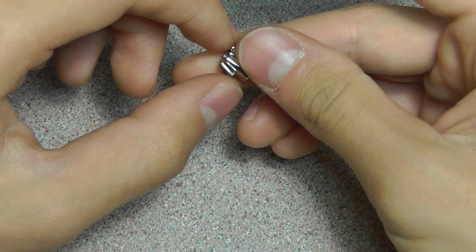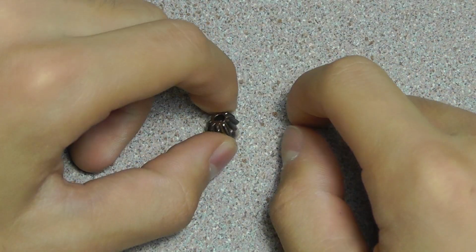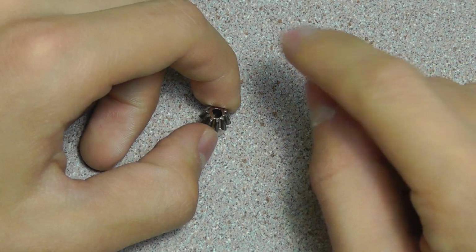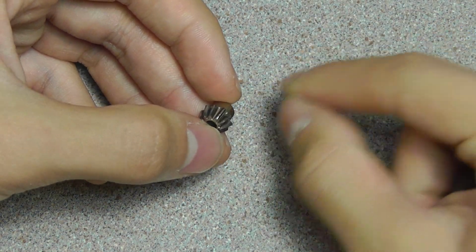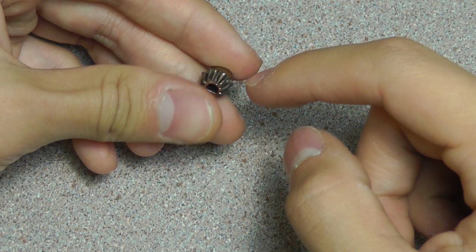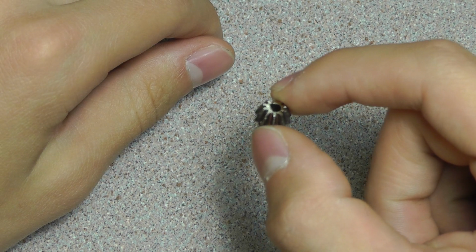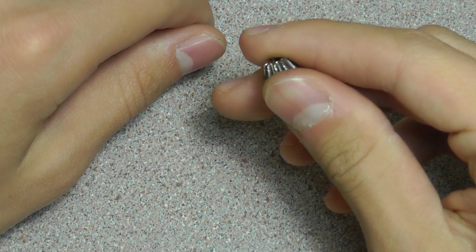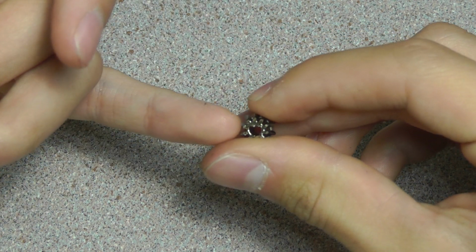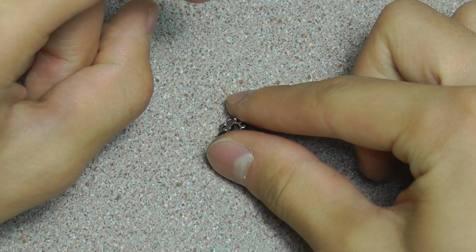But yeah, the only other thing that concerned me when the coating flaked off was that I saw little flakes of it in my actual gearbox, and my concern would be that it works its way into the motor, into the armature and the windings and all that. That's a bigger concern, so if you can, I wouldn't recommend it, just because there are straight chromoly pinions like the riotsc one out right now that I would just go for, and then figure out how you would affix it to a D-type pinion or D-type shaft if you have that. But yeah, that's my review of the TX pinion.